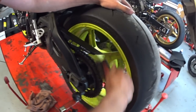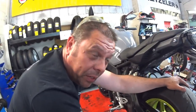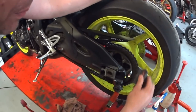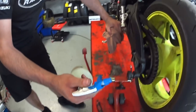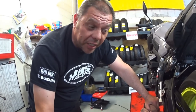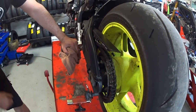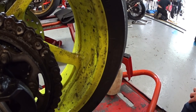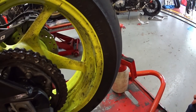The easiest way to start is with a wire brush — just a simple little one — and just clean the plates and loosen the dirt up as much as you possibly can. You could do it quickly and be done with it, or you can take your time, have the music going, have a tinny. This gets the dirt moving so we can get it off. We've got two cleaners — I like this one, it's a detergent-type cleaner that won't upset the O-rings or X-rings in the chain. It breaks down the dirt pretty quickly. Watch this — the filth just comes off!